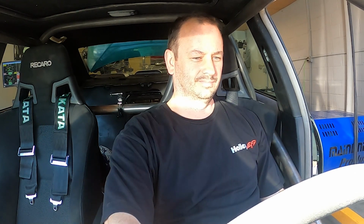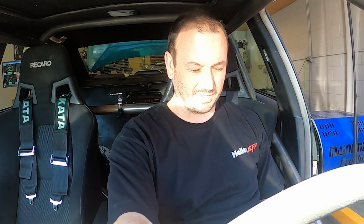Found out that where the battery itself was grounded to the car, that connection was loose. All right, found a new potential issue. That's the main ground for the battery. It seems promising. Let's try this one. Tighten that up, and then luckily that corrected that. All right, moment of truth. I thought we were in the clear last time, but it wouldn't start the second time, so let's try it again. All right, I think we're back in business.